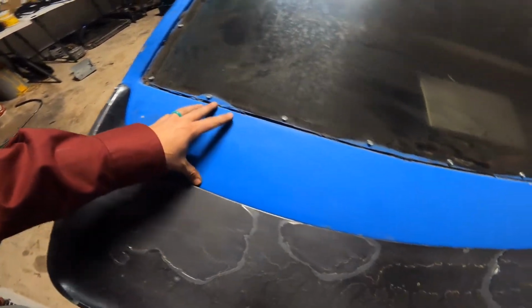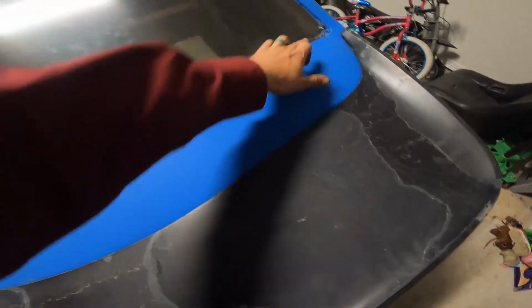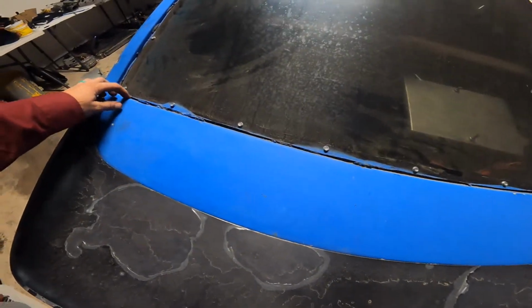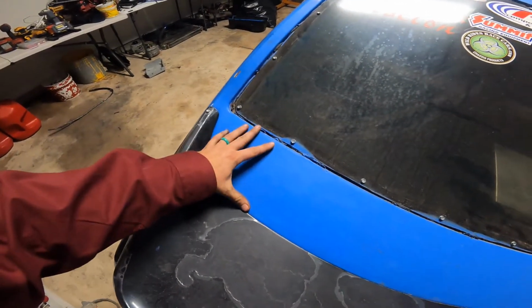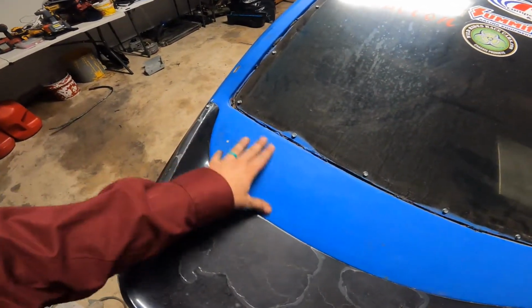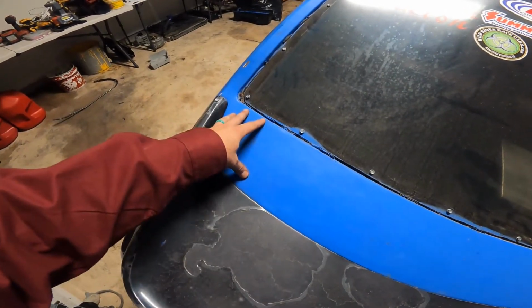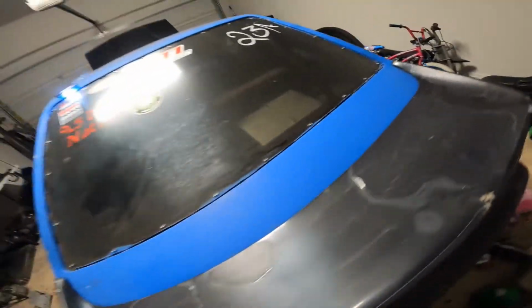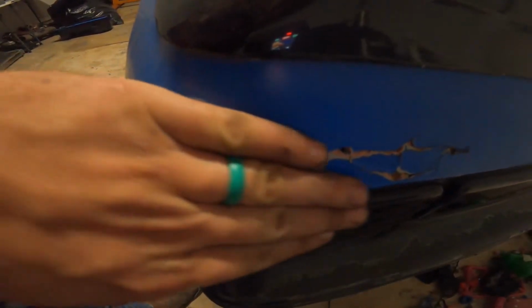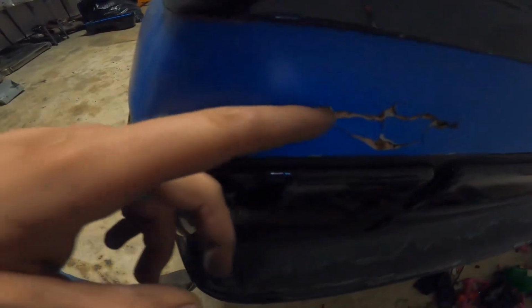Don't think too highly of me. There's rust holes up here, mainly up against the bottom of the windows, like up against this edge. So this has all been, granted, I sanded all the rust out, sprayed it with rust treatment, and then I bonded the whole top, sanded it, made it look good. But it's also got, here is a bad rust spot, and then here, which is a very common place, is a bad rust spot that obviously I did not do well enough repairing.